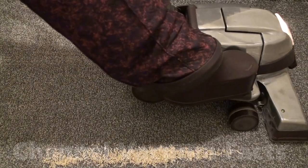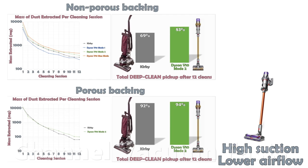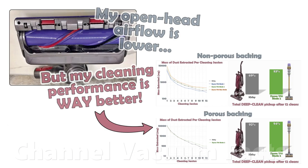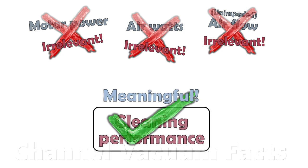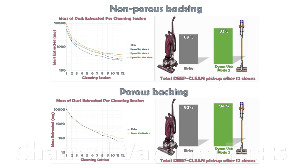Aggressive agitation and very high open hose airflows are irrelevant to achieving good cleaning performance. Dyson have always claimed that high suction is very important, and this data shows they're right — the reason being that it prevents loss of airflow through resistive pile. The Kirby's high airflow plummets on non-porous carpeting, and even when its value remains high on porous carpeting, it doesn't achieve any better performance over a Dyson stick vac with lower airflow at the open hose. Numbers for motor power, air watts, and airflow are also irrelevant — only the actual cleaning performance has any value. Cleaner head design has a far bigger effect on deep cleaning performance, and Dyson have achieved the greatest cleaning performance through that combination of good head design and airflow-maintaining suction, using very little airflow and power.